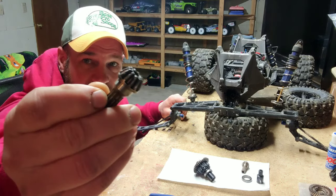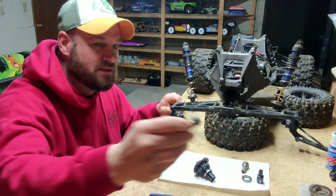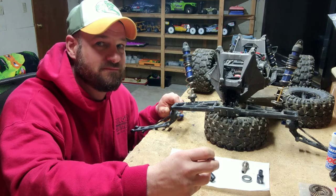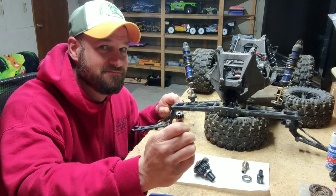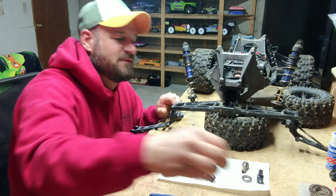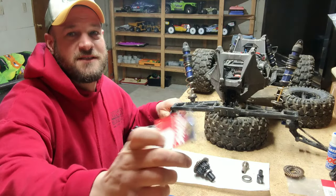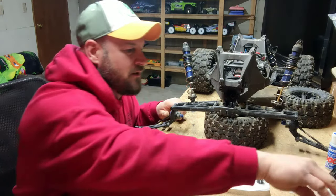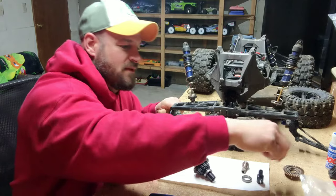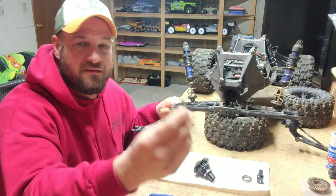As you can see, the edges are quite beat up. Sometimes I've had them where they don't look too bad and I use them — take my advice, listen to what I'm saying. It takes your gear out, and I'm talking from prior experiences and pain. So I always change both. It's $77.91 — ring and pinion. Let's start with the pinion. Real easy.